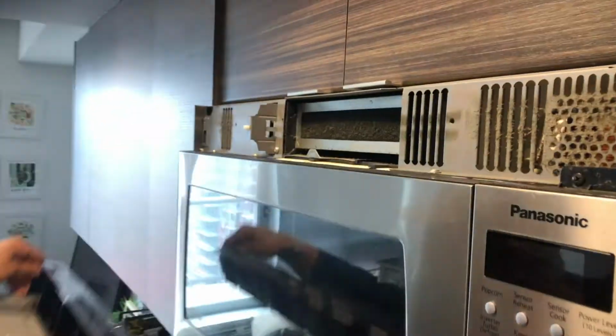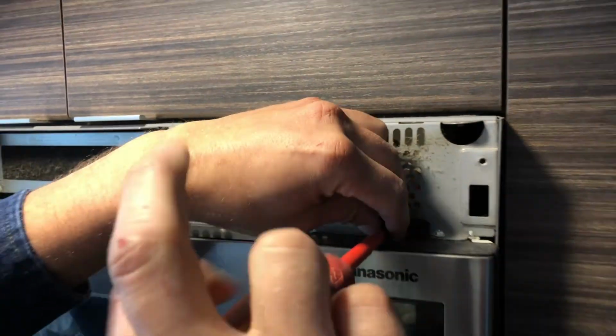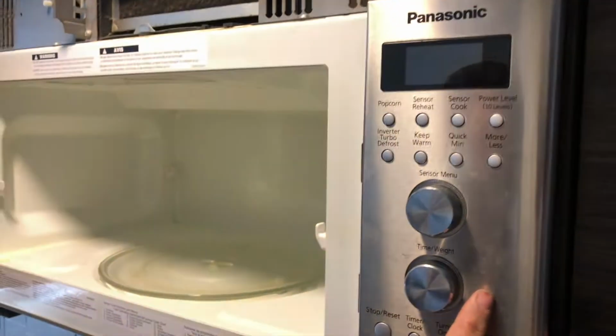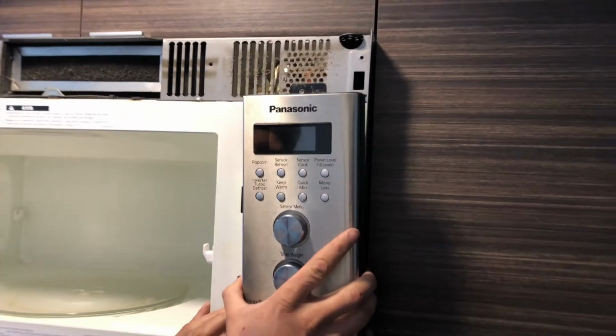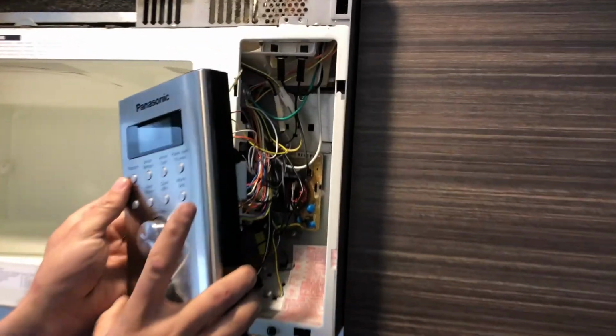In general, the door latch consists of the plastic housing, very sensitive and very fragile, with 3 switches on it. And switches are very cheap. They're like $5 to $10 each and easily can be burned out in case you shut the door or even slammed it. Once you have the door open, all you have to do is push up and pull out. This releases this. Within time, the door latch gets worn out, and that's kind of a natural process because you shut the door and the most pressure is on the latch itself.